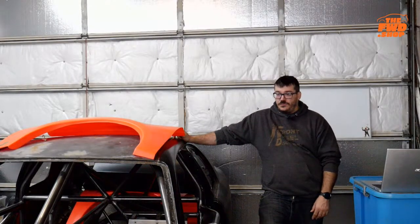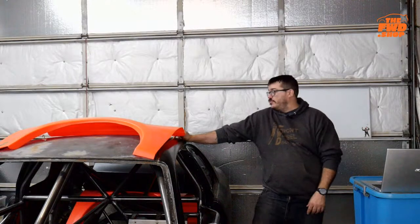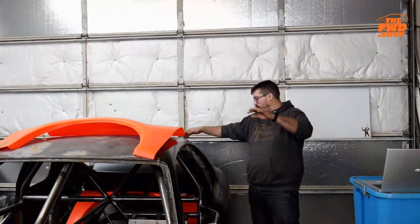If you guys wonder how much you can actually change the handling of your car, if you have coilovers, raise your car up, adjust an eighth of an inch, and set it back down and see what the weight does. Raise it back up, do that, and then think of how hard you would have to twist the car to get the top of your strut tower to move that distance, okay? If you can move your strut towers a half inch, you can move your right rear down a half inch compared to your other three, yeah, you're going to add a lot of wedge. A decent amount, I should say. But if you can get it to move a 16th of an inch, it ain't worth dicking with, right?